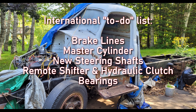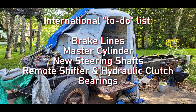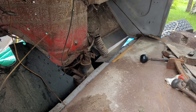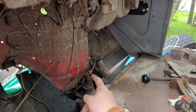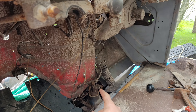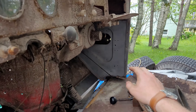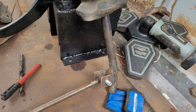And that pretty well brings us to where we are now. My goal for this year is to have the truck be capable of moving and yard driving under its own power. To get us there, here's a list of what I plan to tackle. Today we're going to look at getting the shifting linkages sorted out. The issue I have at the moment is that my shifter tower comes up out of the floor directly beneath my dash, and there's no way for me to use the shifter from there. So what I'd like to do is move it back about 14 inches to roughly here so I've got room and I can shift no problem.